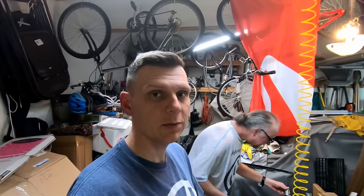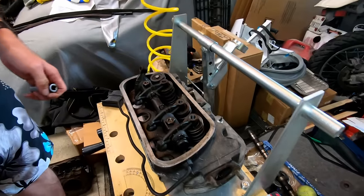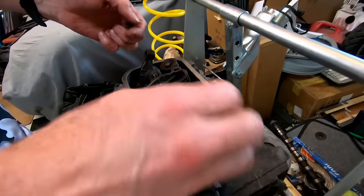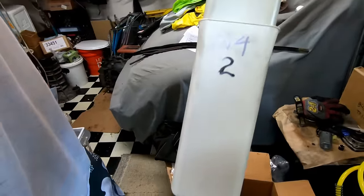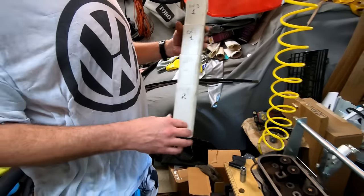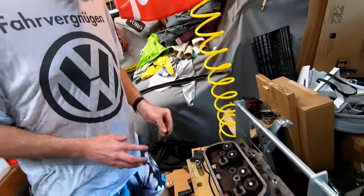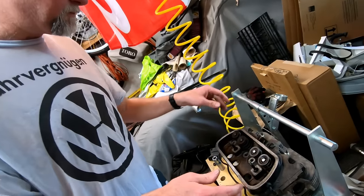This is Mark's shop. First step is we've got Mark's head on his bench and he's got this special tool here that removes the valve springs and everything. First step is just to take off your rockers — you can't do this with a rocker on there. Keep all your stuff in organizers; I've made one for intake and exhaust for the pairs of cylinders. You do one head at a time — ones and threes, then twos and fours — so I can keep track. I'm also going to label the actual head so I know which cylinder I'm putting on which spigot.